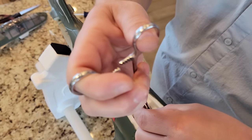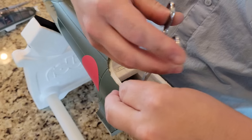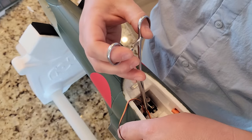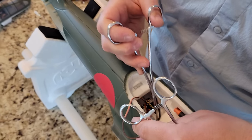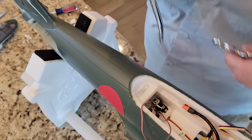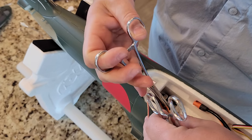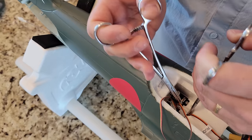I want to keep a loop back because then I can use it to pull the wire down once I've established where exactly the receiver goes — then I can tuck it all back there like luggage space. Never clamp forceps directly on a wire — you will cut it. I'm going to clamp here, let go and walk it forward. This is the kind of nitpicky trick we bring for extra value on Brian Phillips RC — we show exactly how to set this stuff up.